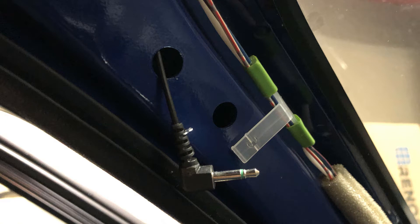I fed the wire through the hollow A-pillar, then used some needle nose pliers to get it out, and routed the microphone down the rest of the wire bundle. Moving down the left side of the car right alongside the driver's door, there are two small rectangular panels used as covers over the bolt locations for the dashboard. You don't need to remove any of the larger trim pieces — I was able to fish the wire down through the side just by removing those little rectangular covers and using a fish tape down through each of those holes.